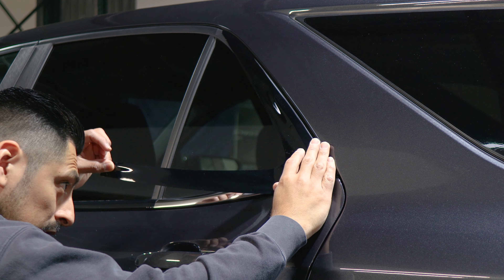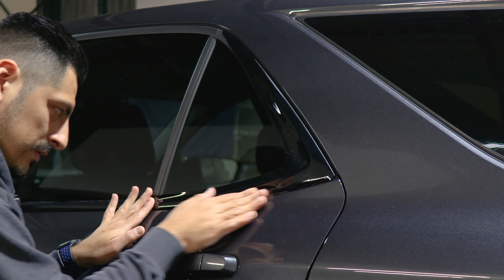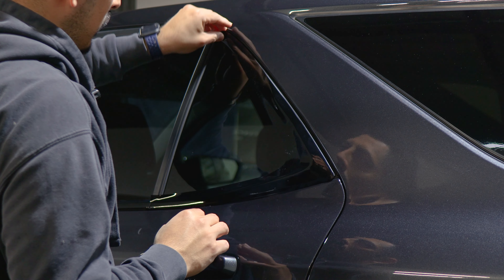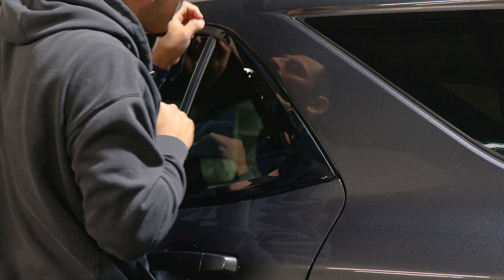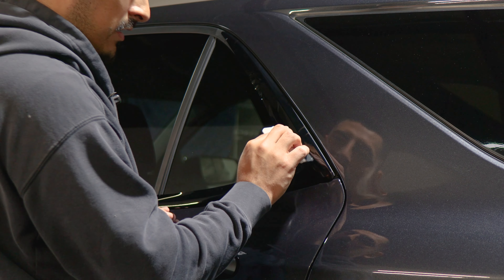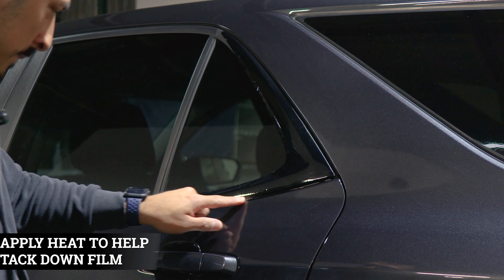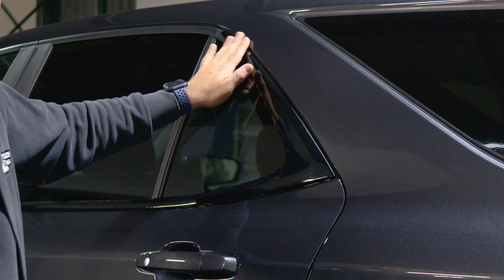Make sure it's aligned on the bottom half. Tack down just the flat surface first because on the curve side we'll apply heat to help it tack down — it will lift if we don't apply heat. Lift the film just to adjust it, and make sure you're giving yourself enough material to cover the chrome here. Start squeezing and tacking down everything. Now apply heat on the edges, helping it tack down on the bottom half, on this curve, and on the side panel as well.